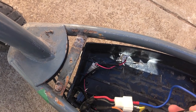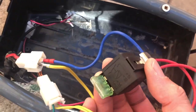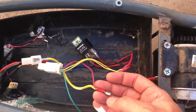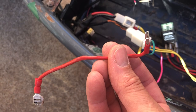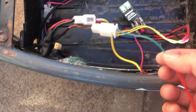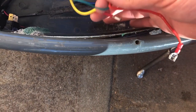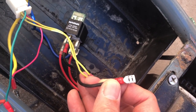These motors are 24 volts, so the batteries are going in series. The other thing — because it's actually a 12 volt relay — what I've done with this wiring is I've kind of hooked up the power to go up to the controller. It'll just come off one of the batteries, so you've got 12 volts to power, and then this is effectively the jumper lead to go between the two batteries, between the plus and the minus. You can see this wire will be the exciter side, which will then just pair up with one battery — basically the plus and the minus there — the jumper across to the other battery, putting two batteries in series, and then we'll get 24 volts going through the relay. So I'm going to hook the batteries up now.